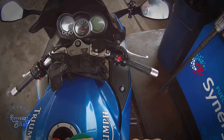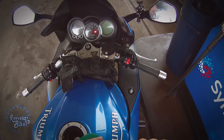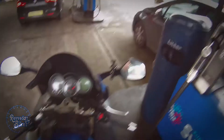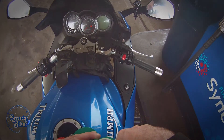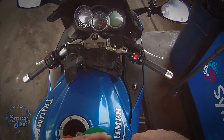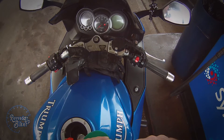All of a sudden you're back up to 14.5 volts again, which is incredibly strange. I've been on a few forums and they've said it's possibly the regulator rectifier that's at fault - the actual regulator part. But I think I've just got a naff regulator rectifier, so I've loosely wired it up at the moment. I probably need to go get another one and get it working.